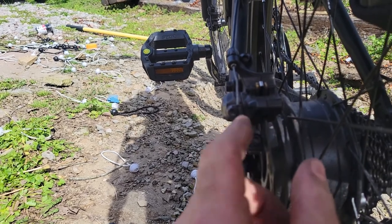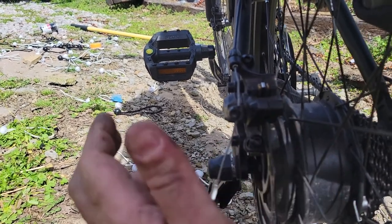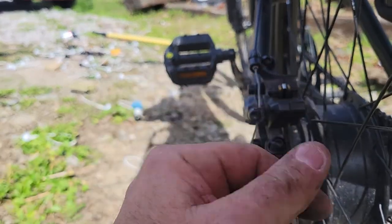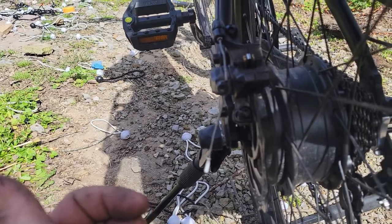I've got another set of Shimano brake pads coming. Whenever I change these pads out and put the new pads in, I'll show you how that's done. It's real simple — you just take out these two bolts, lift the whole caliper off, drop the old pads out, drop the new ones in, and then readjust it.